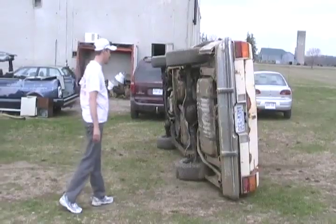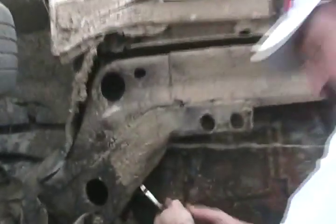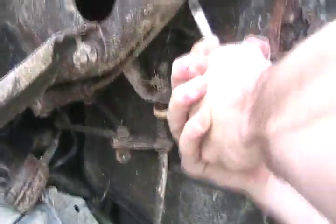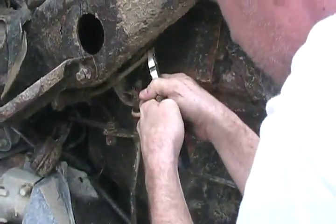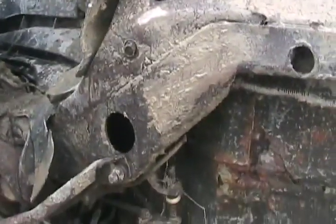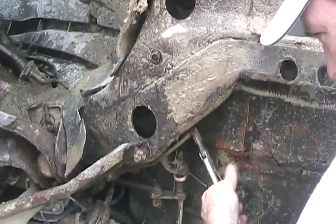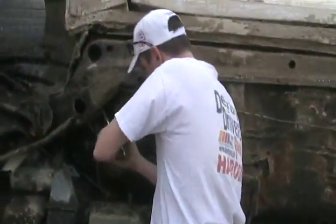Looks really dead from this side — that's got a lot of surface area, we should paint a flag on it or something. We're gonna use a double-fold technique on the brake line, so you snip it off on a nice clean spot. It's a little bit weak there, so you rock it this way — rock it when the line is weak. That's enough, now you pinch it back about one and a half inches, maybe even one inch, till it's flat. Just keep re-squishing it — you'll have to do it in like two stages. He's a derby driver so he ought to know.